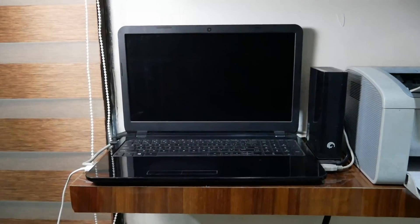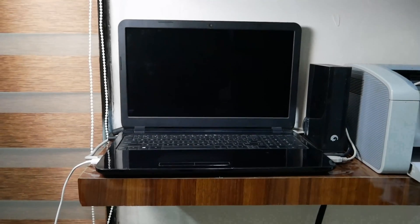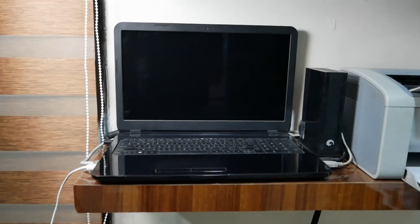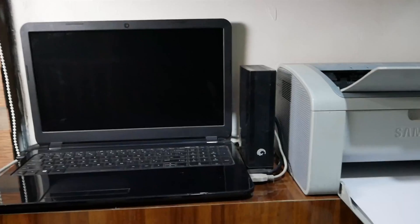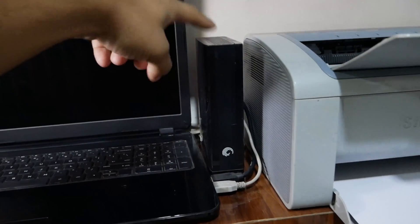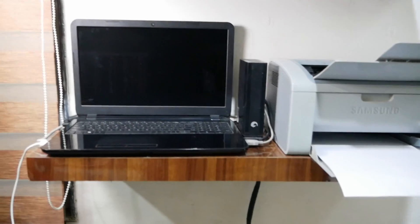To create a server you can use any old PC lying in your house — a laptop or a desktop. In my case I have used this old HP laptop to create the server. The screen doesn't work but it has a good processor and graphics card, so it can handle a lot of things. It can not only serve as a printer server but you can do a lot of things. For example, I have used this laptop to create a NAS — Network Attached Storage. I have a 2 terabyte hard disk connected to this laptop and I have shared this 2 terabytes of space on my local network.